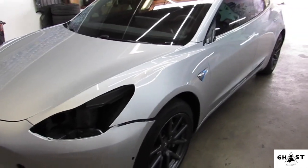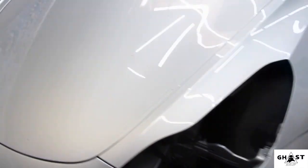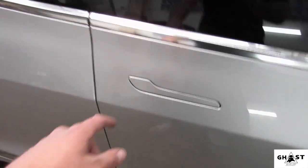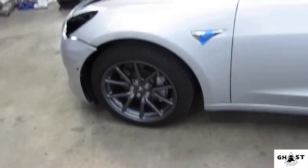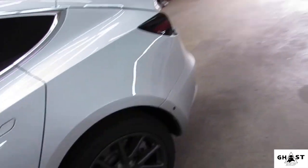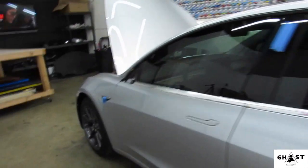The whole car is taken apart. I just put these bumpers on so I can move it outside. It's a little dirty because it's been outside for about a week, so I'll clean that up. We're moving it and gonna block it up. First step is to take off the wheels — we took the caps off and broke them all loose, so now I'm gonna jack it up, get the wheels off, take those calipers apart, and wipe it down from there.